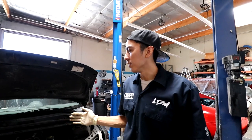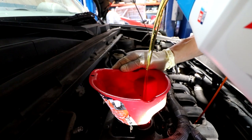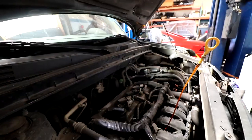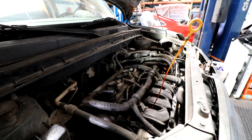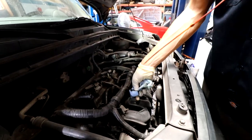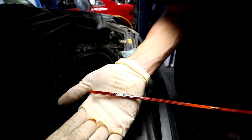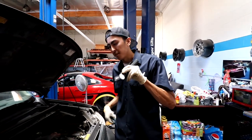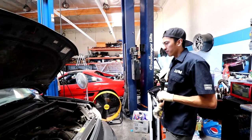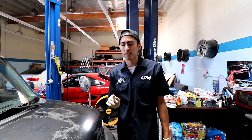Make sure there's no residual oil anywhere, and give it a nice once-over again checking for leaks in case you missed anything — you might catch it the second time around. Double check your work. Once you have the vehicle on the floor, the only thing left to do is pour the oil, check the oil level, and call it a day. Once you've got the oil in the vehicle, go ahead and start up the car and shut it off. Final step: check the oil level. Then give it a nice once-over to catch anything you may have missed, close the hood, and depending on your dealership, put a lube sticker for their next service.